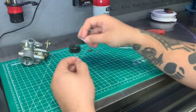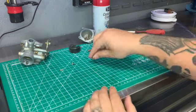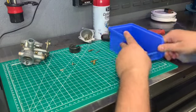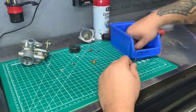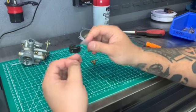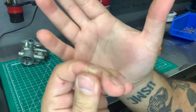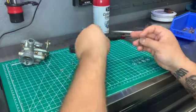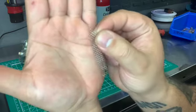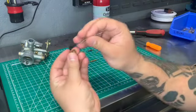When you clean your jets, this hole is big enough inside the main jet that you can see through. If it's dirty, all you have to do is use a carb cleaning kit. What I found to work the best is a wire from a tire patch kit — it can be from a tire patch kit, a plastic patch kit, whatever. This gauge wire works perfect for cleaning out idle jets, pilot jets, and main jets. All I did was grab this mesh wire and pull one wire apart, and I used that to clean every jet.